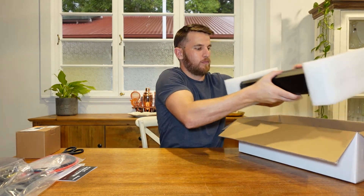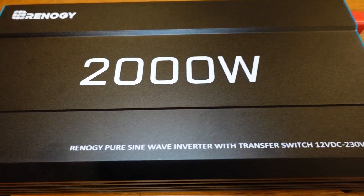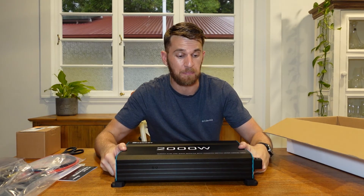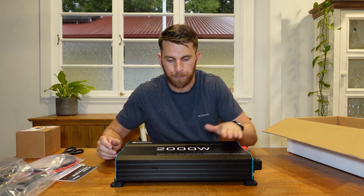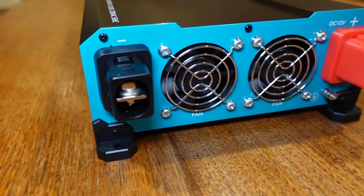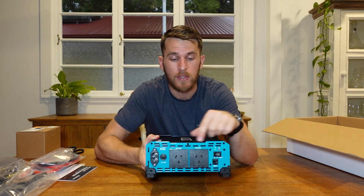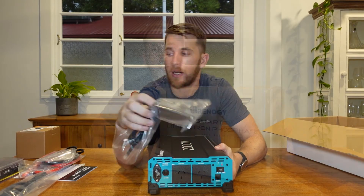You can tell that this is really well built. This particular unit will be able to charge anything extra that I need. 2000 watts is above what I'm expecting to use, but I wanted to build this system with enough power so I could upgrade in the future. I'm not going to be housing many appliances within the van to begin with because I am on a budget, but if I need to put in a heater or a big water pump, this will be able to handle it. On the back of the unit, you have your connections for positive and negative that will run straight to the battery. I'm creating a separate circuit from what I will for the 12 volt system. On the front, you have two household plugs and your on/off switch, plus a plug that connects to the remote switch I can house in the van anywhere I like.